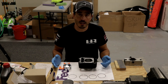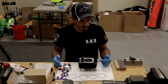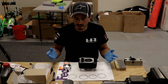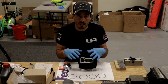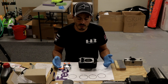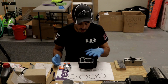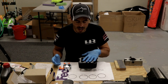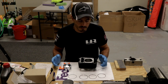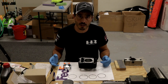A lot of guys will do this themselves and some instructions give you somewhat of an idea of how to do it, but this is a little more in depth. We have a whole bunch of different tools to show you that you should use if you want to do it right. The better you do this, the more accurate it is, the longer it's going to last. Everything comes down to half-thousandths of accuracy, especially in an air-cooled motor like the Grom, because the piston swells. So everything has to be pretty accurate, otherwise you get it locked up.